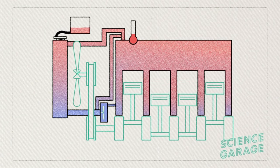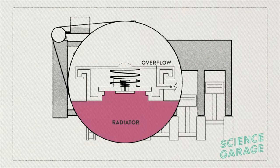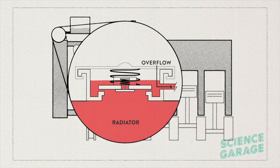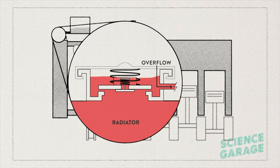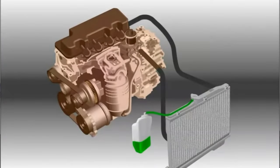Here's where it gets more interesting. As it gets hotter and hotter, there's a radiator cap rated at about 15 PSI. Once it reaches a certain point, it develops high pressure — that's why you should never touch the radiator cap if your car is overheating, because it will burst and burn you. If that pressure gets too high, the coolant will overflow into a bypass, goes into an expansion tank, and fills up there so it doesn't spill out or create too much pressure. The whole point is that the radiator needs to be as efficient as possible. Then it goes back out and returns into the pump — right back into the heart — and the cycle starts again. That's the basic of liquid cooling; it works extremely well and modern day cars use it.